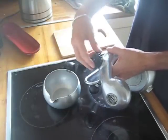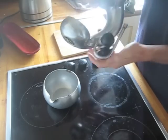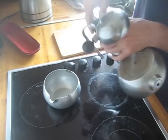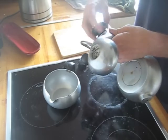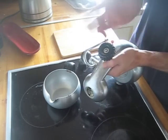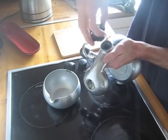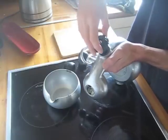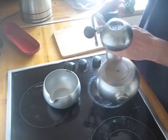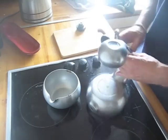If you do have a sealed knob, my advice would be to get something like a Black & Decker Workmate, wrap a dish towel around it and put the machine into the Workmate and try and twist it out. I think I've only ever once managed to get the knob out intact. What normally happens is the Bakelite shatters, and you'll end up having to get some pliers on the metal bit that's left and use brute force to get the remaining metal out, and you'll have to buy yourself a new steel knob.